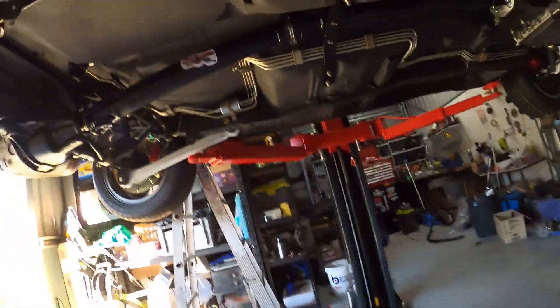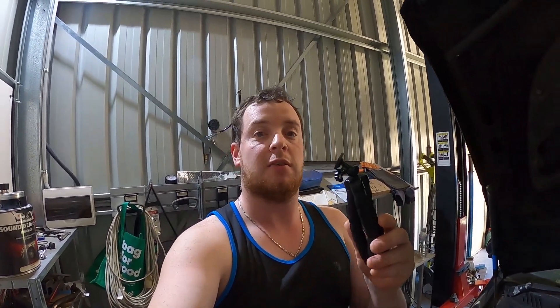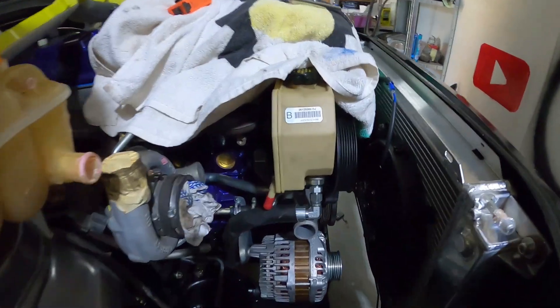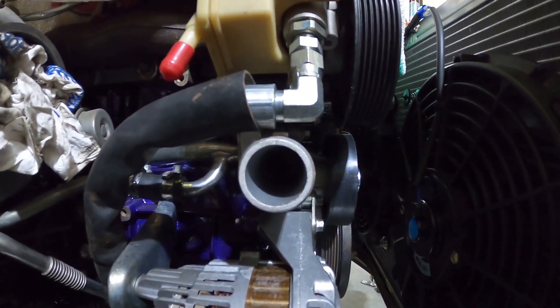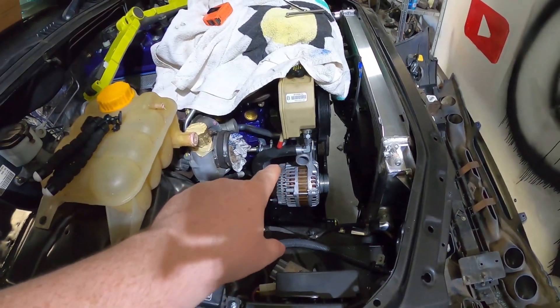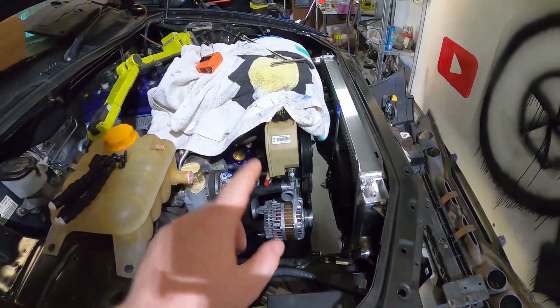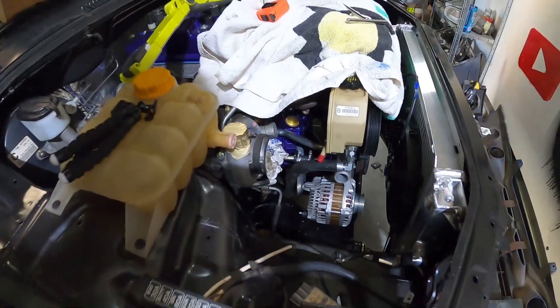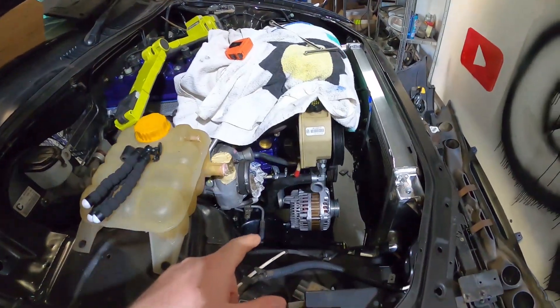It's another day back in the shed. About a week has passed. The power steering line is done. As you can see, the line is adapted in there — not a whole lot of room, but hopefully enough to get the hose and hose clamp on. They shouldn't move independently of each other. The hose is done, not touching anything, nicely crimped. Apparently the restrictor is still in there as well to stop the force feedback through the steering wheel.